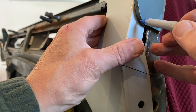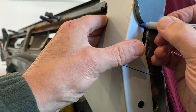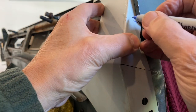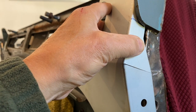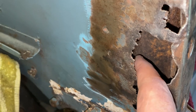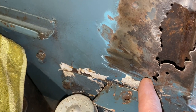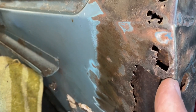So I'm going to mark a line here just to give me some reference, probably right here and not too deep in. It'll probably pull the whole side up here to the bend, just so that will fit over. You can see deep in here that there's part of the bulkhead, so I don't want to trim it all the way into that. I think I'll just cut out the rusty portion all the way to here, and then over and up behind the top bolt for that captive nut plate.